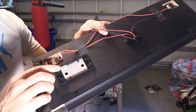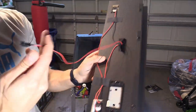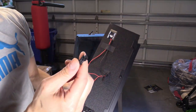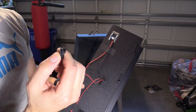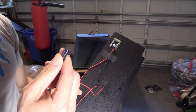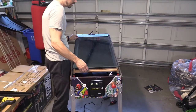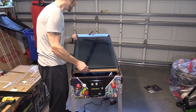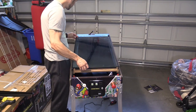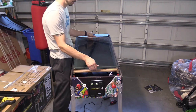On the control panel it's easy to unplug — it's just one connector right there. You pull out, and there's a connection right here for the haptic feedback exciters. You just squeeze this and then pull it out — make sure you don't pull on the wires. The glass should slide down and out. This is pretty thick glass, actually.